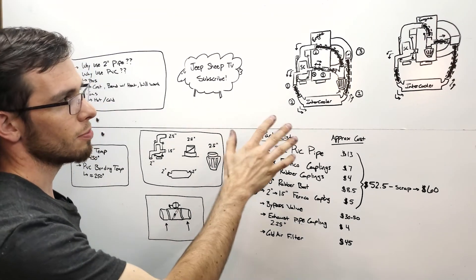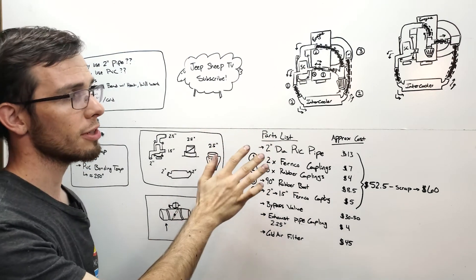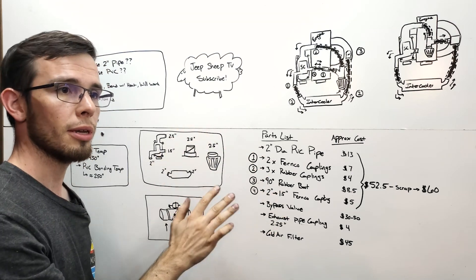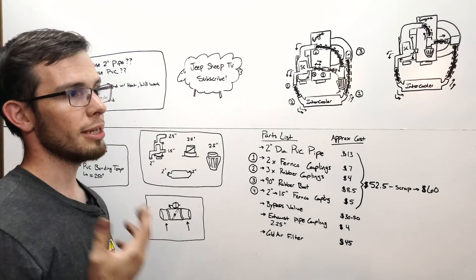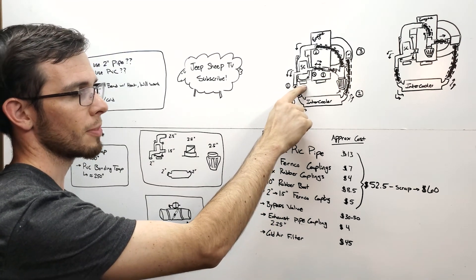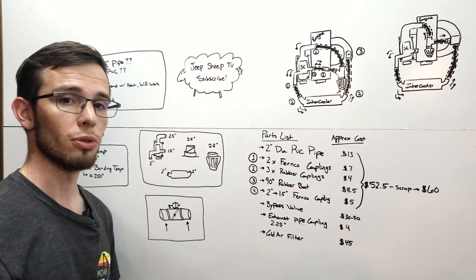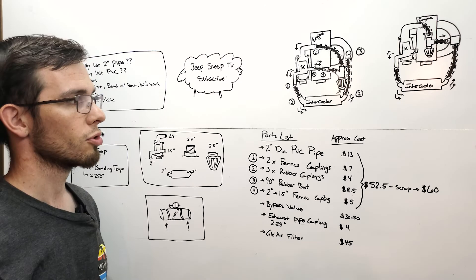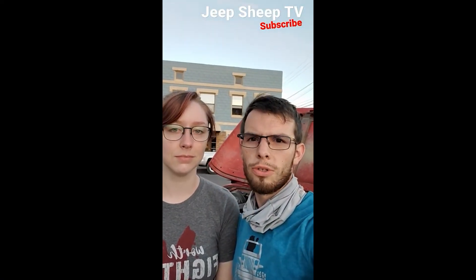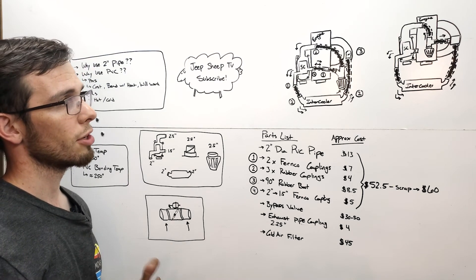With this method, we're taking advantage of the intended design of the supercharger. I ended up making this project even more difficult by installing a supercharger with a clutched pulley. One requirement was being able to turn the supercharger on and off — if something goes wrong I'd like to prevent engine damage or continue on longer trips. We're driving this supercharged 2.5-liter four-cylinder YJ across the country, and a clutch supercharger was important for that, though it brought a lot of challenges.